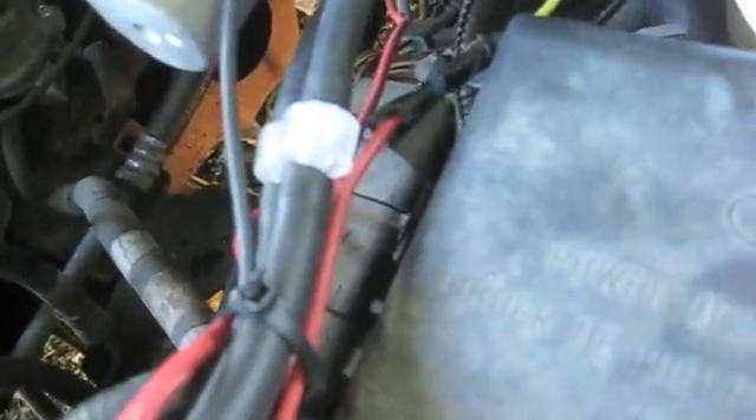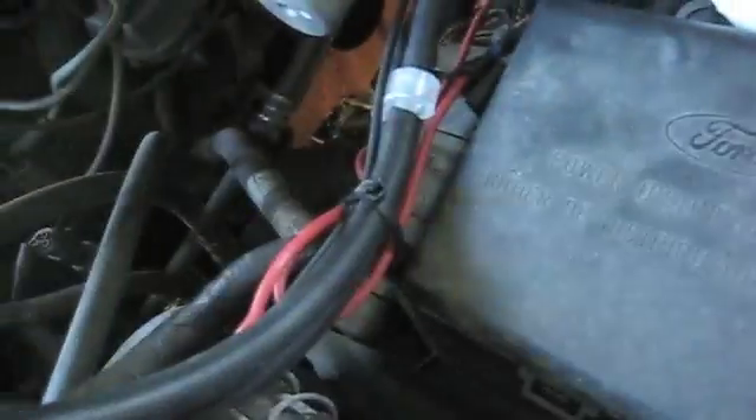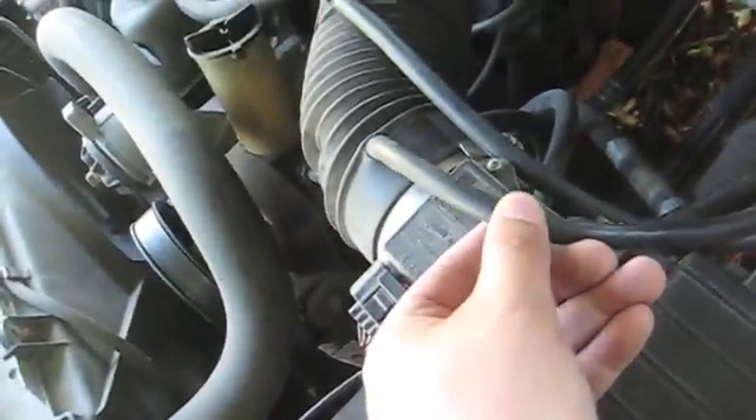The tube itself — I followed everything it said to do. I have a bubbler, a pressure release valve, and these one-way valves I picked up at a fish supply store. Gas can only flow in one direction; if any gas pushes back it closes the valve. I'm pretty confident both the vacuum line and the intake hose are needed: at low RPMs the vacuum line pulls hard enough that it closes one check valve, and when you open the RPM the intake hose pulls hard enough to close the other. This one pulls stronger at higher RPMs and this one pulls stronger at idle, so both just make sense.